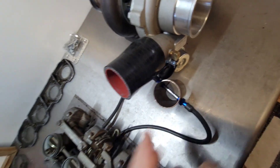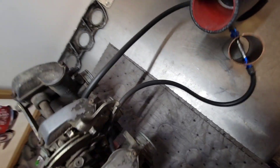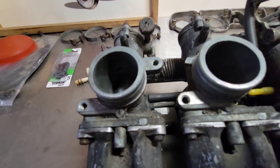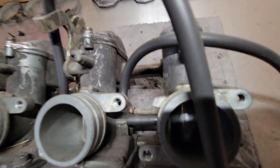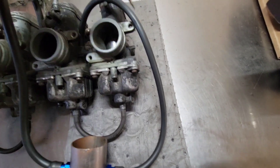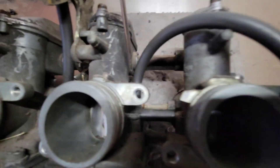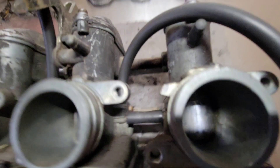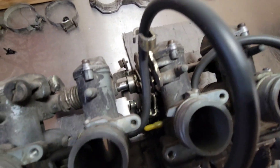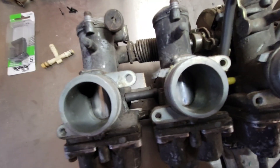Some goes here, some goes here. I have it set up on the carburetors now where two lines come down. I have the mounting plate taken off so we can see a little better. It comes up here, goes in right here, and splits directly off to this carburetor here — so these two share pressure from this side. This one comes up, goes in right there, goes through this carb and splits off to this carb — so these two share pressure from this side.